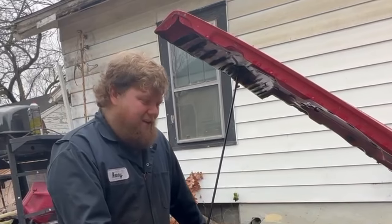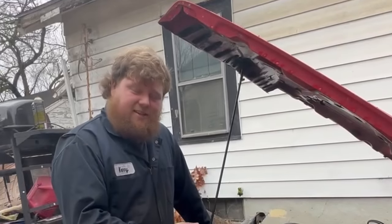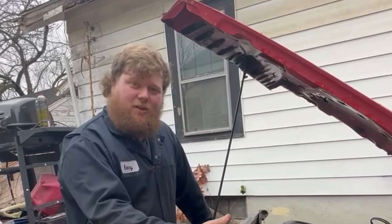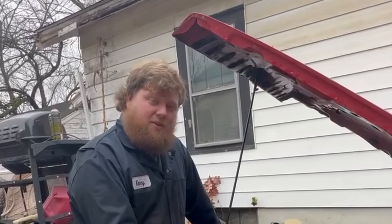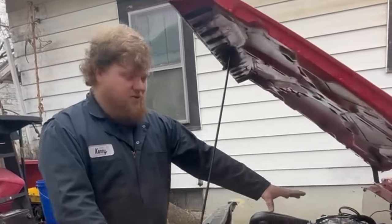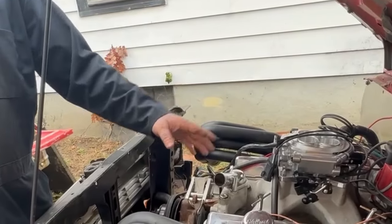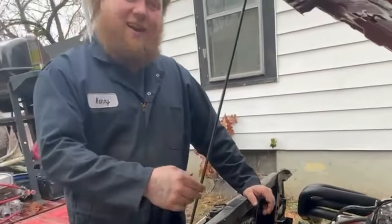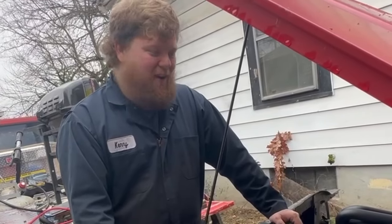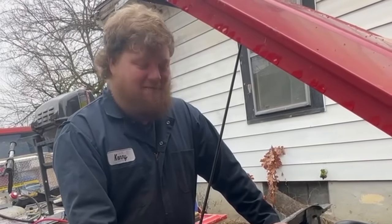There's a lot of old school guys back in the day, you used to be able to put flamethrower kits on your exhaust. The way some of them work is it's got a jet that sprays some type of ignitable substance into the exhaust, and it lights it and blows it out. Some of those kits work that when you push the button down, it grounds out your coil. You lose spark. So you rev it up, push the button, it kills the spark, and you just sit there and stomp the gas. It pumps gas into your exhaust and then ignites that. It's terrible because you're running dead straight rich with no fire except for the fire in the exhaust itself. Looks cool, terrible for a motor.